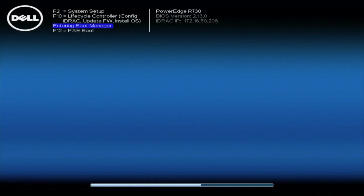Before we start our local installation of Windows Server, there are a couple things we're going to need. First, we want to make sure we have some type of storage space available for our installation. This can be an external or USB drive, an M.2 SSD plugged in through a PCIe to M.2 adapter, or a SAS or SATA drive plugged into the backplane. For our case, we will be using a SATA drive plugged into the backplane.